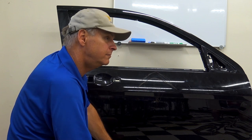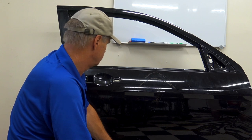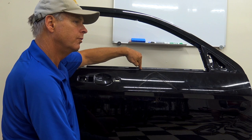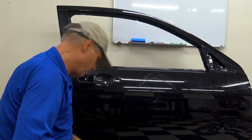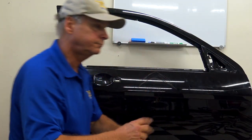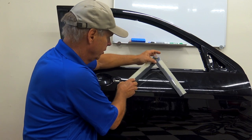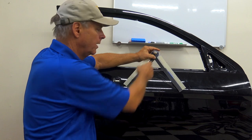How about when they wash past the body line, like up in that door there, like where the belt molding is, see that top line? Sometimes the crown will wash past. Oh, well, now since you brought that up, that is the perfect question. You just asked, what happens when the crown goes past it? You see two lines, but the crown would have been up there had there been metal up there.